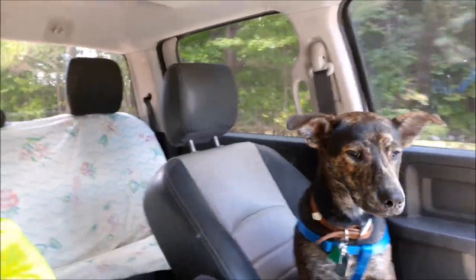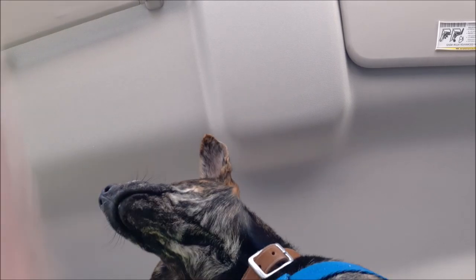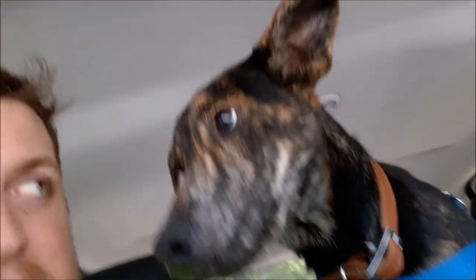I'm about beat — the sun was creeping out on me. Rusty was over here just chilling in the garage with the fan blowing on him. The bags are in and this is the first test ride. I put them up to a little over 20 PSI, not quite 25. They recommend bumping up to 30 to 35 PSI for towing, so I figured 20 would be decent for just riding around. Let me buckle up — let's jump on the highway and see how it handles some bumps.